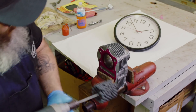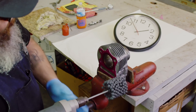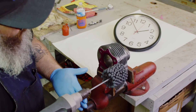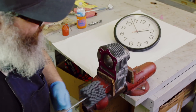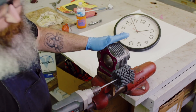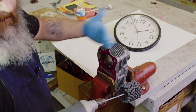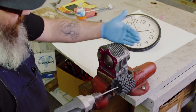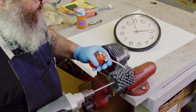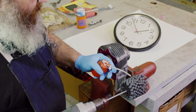Here's our technique. It's important to keep the hone level and fairly straight into the bore of the cylinder. We're going to get a running start — meaning I'm going to get the drill going and then plunge the hone into the cylinder. We're doing a stroke back and forth, about half a second per stroke, so one stroke per second. I'm going to get about half of the hone out of the cylinder on every stroke. We're going to do that for 25 seconds at a smooth pace. The last five seconds I'm going to really bring the speed up and go a lot quicker, then exit with the drill still spinning — always get a running start. If your hones are new, put a little bit of oil on the dingle balls themselves and soak them.